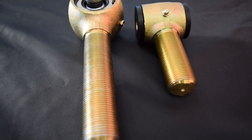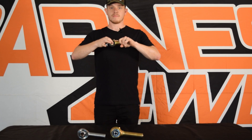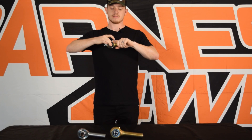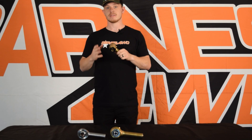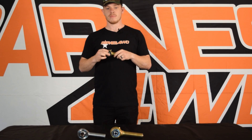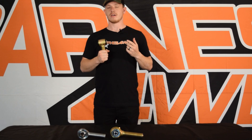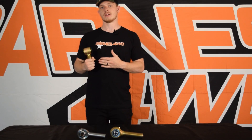The really only downside is that it's not great at articulating. When your vehicle goes under flex, it puts tension through the bolt that's attached to the frame or axle, and putting a lot of that tension on this type of joint over time will prematurely wear the polyurethane and lead to premature failure. We don't recommend them for off-road racing or serious rock crawling — really just for the daily driver who also likes to get into a trail every now and then.